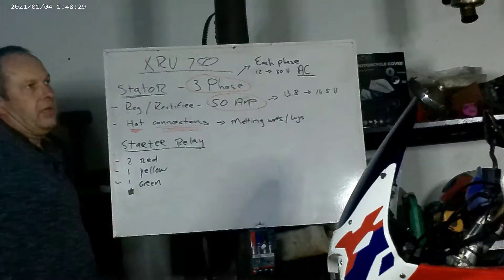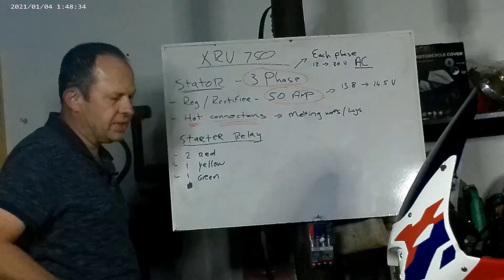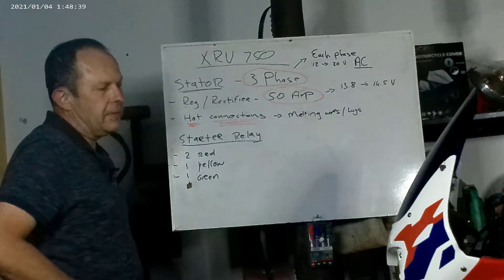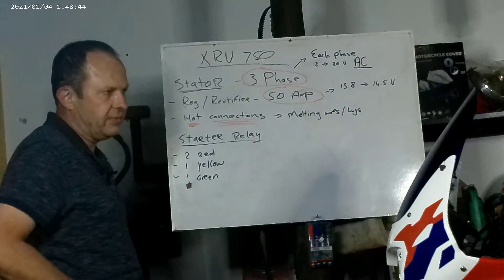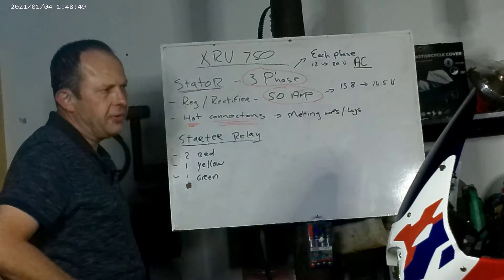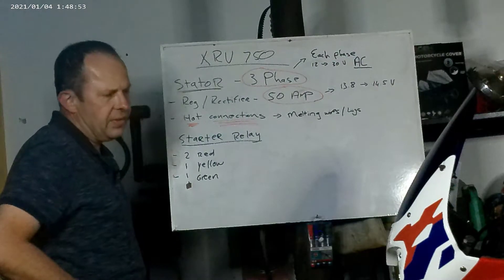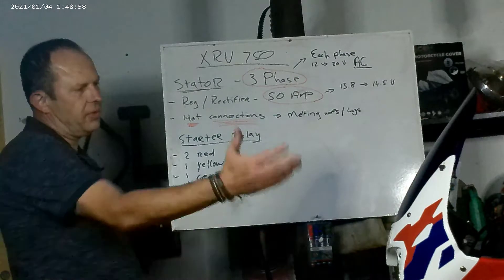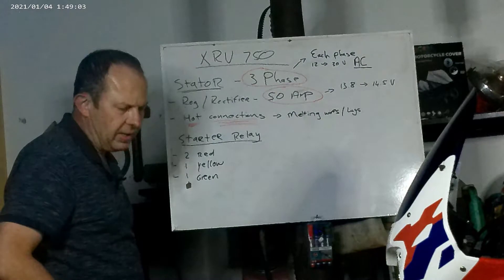The rectifier regulator fix is one thing, but I want to do a simulation for when you're on the road whilst riding and your bike cuts out completely dead. First, check your negative or positive terminal on the battery. If it's anything further than that and the poles are still tight, then you can remove your side cover on the right-hand side - standing in front of the bike, right-hand side - and have a look at the wiring on the regulator rectifier.